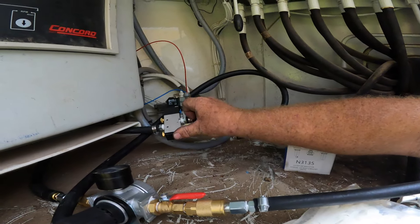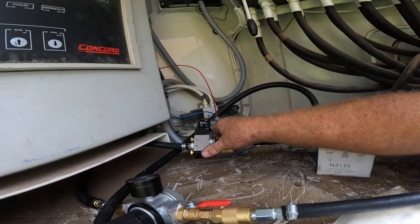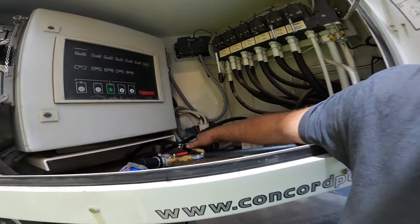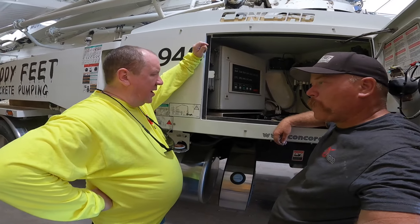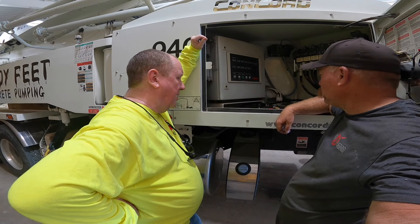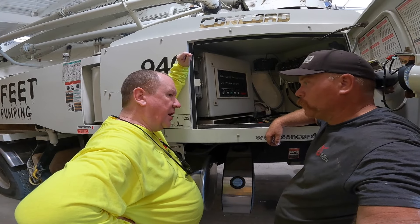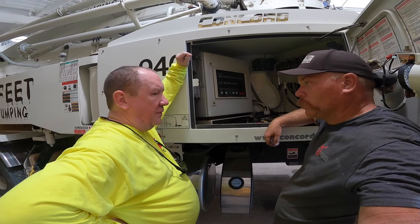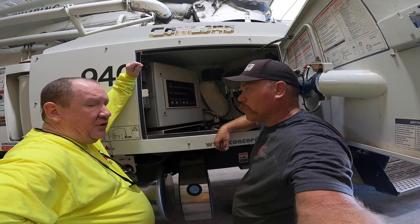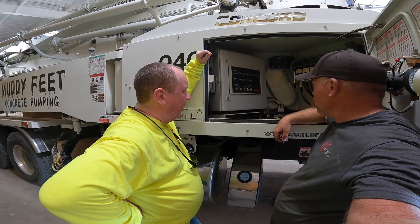It's wired in — this is a 12-volt solenoid. I did see there were some 24-volt ones as well. 24-volt systems are a little more forgiving with electrical current — you can have a little more voltage drop before it stops working, whereas with 12-volt you don't lose that much before it stops working. So you've got to know if your truck is 12 or 24 volt when you're ordering all the parts to put it all together.